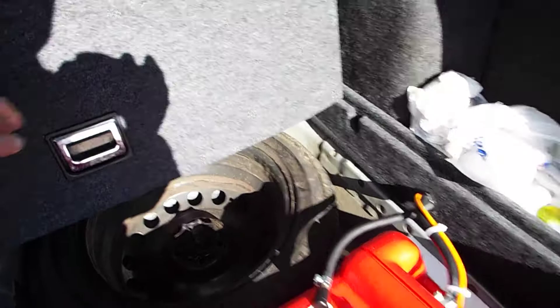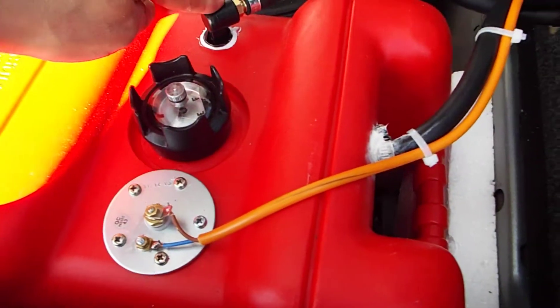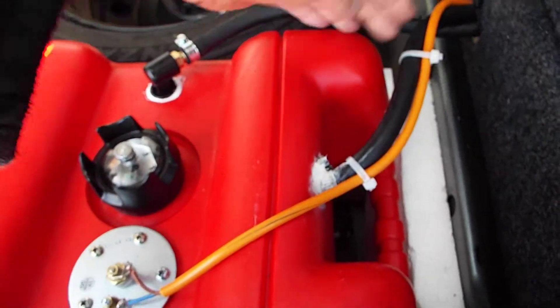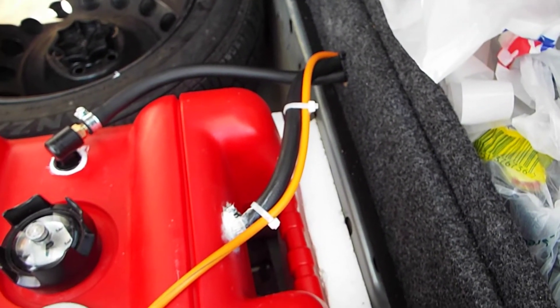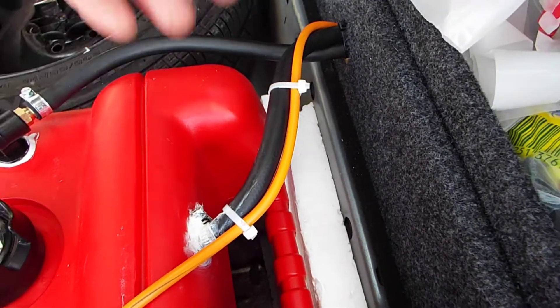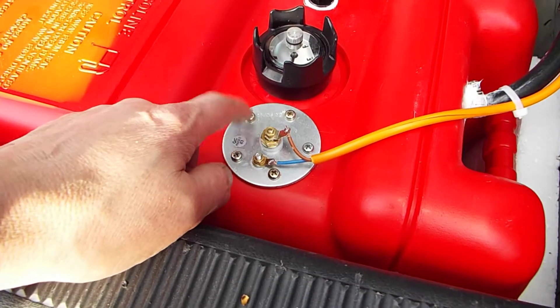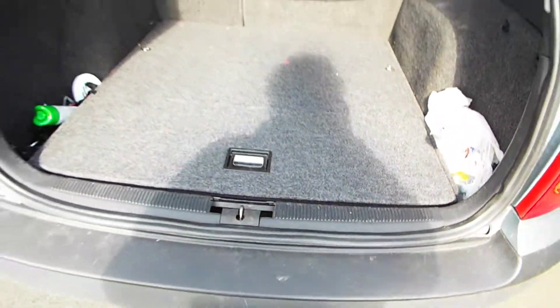Let's have a look at the boot. This is the Elegance model — comes with a false boot floor, which is quite good, because there we have the tank fitted nicely away. We've got the return and this is the pickup tube, so the fuel comes out there, under the floor — I just drilled a few holes in the side and through the floor. That feeds the fuel select valve, and when we purge, this is where the purging fuel comes back. So the diesel will go out of the tank, through the purging system and back, with a bit of vegetable oil. We've also fitted a sender unit which operates the gauge at the front. And you can see that's all neatly packed away.